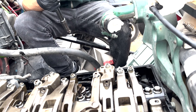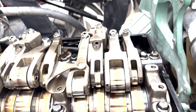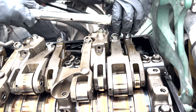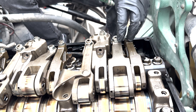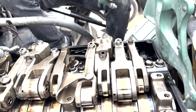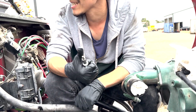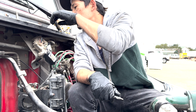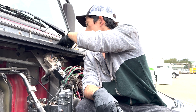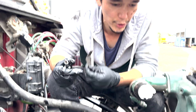Next is the intake — loosen that up. We have this 60-something torque setting. We need the clearance, and for the clearance my engine manual said it's 0.2 millimeters.